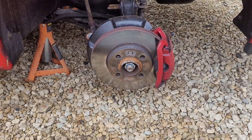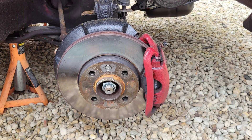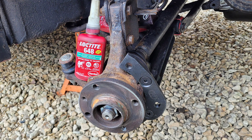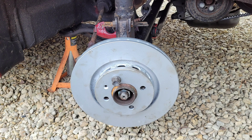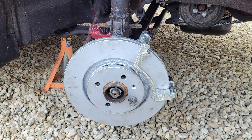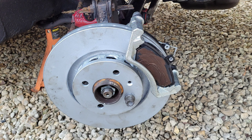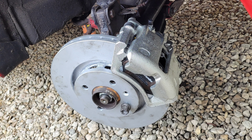We'll go through a step-by-step of what we're doing. Remove the stock brakes and we're left with the hub. Clean up all your hub and where the caliper brackets bolt on. Get some Loctite on the bolts, get a disc on there — 280 millimeters. The carrier goes on and bolts on the back, with some little spacers that sit under those bolts. Once that's on, get your pads on with some copper grease, then your caliper goes on.